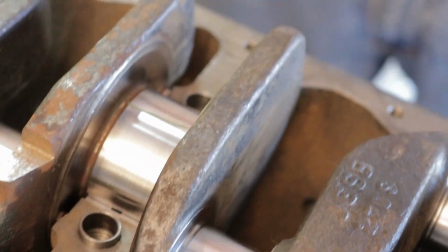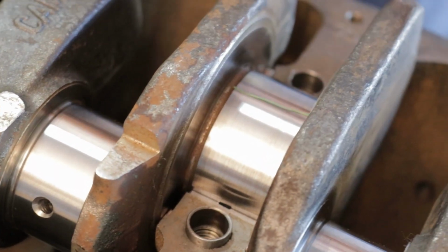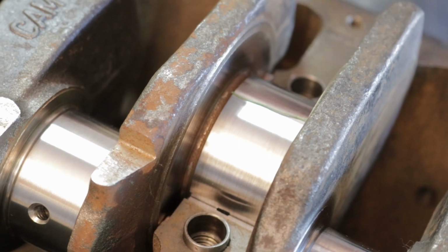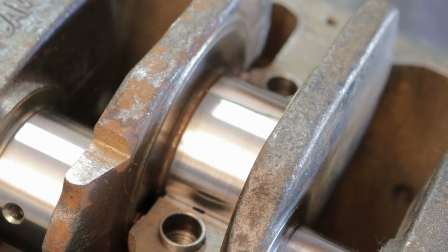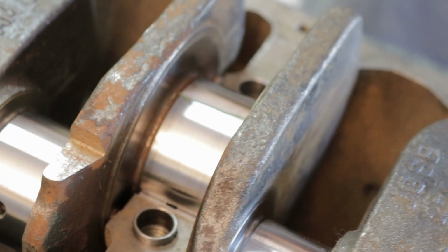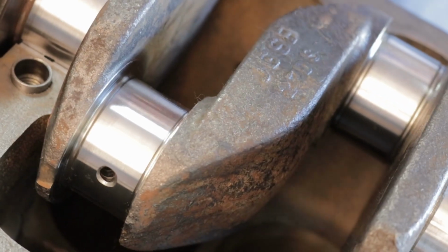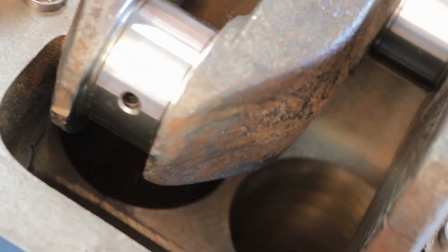You get the correct cap. That's the correct cap. I put the two thrust washers, the bottom thrust washers on, or actually the top, because I didn't want the crank to slide back and forth. But this isn't final fitting, so I'm not going to put the other two in. This will hold it enough for me to torque it down. Tangs both to the same side.